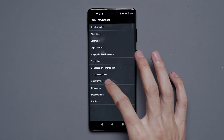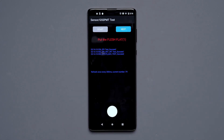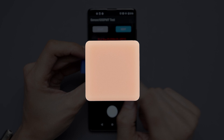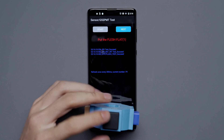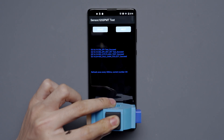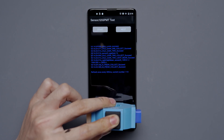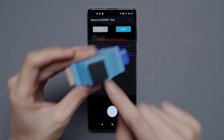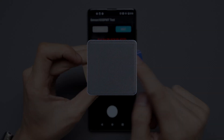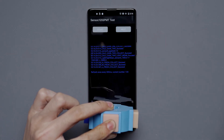We'll go down to the G5S PMT Test and hit Start. We'll pull out the same calibration tool, the 071B. We're going to first use the solid yellow module to cover up the white dot on the screen, and tap Next by applying a little bit of pressure. After a short wait, it'll show 'put the black flat.' Now we're going to use the black module on the calibrator, align it fully covering the calibration spot, and hit Next.